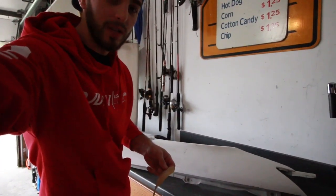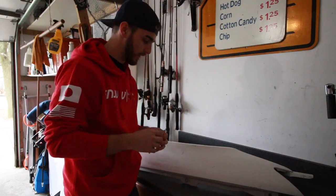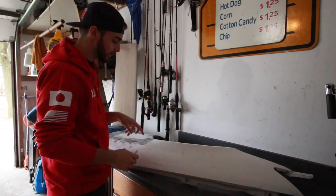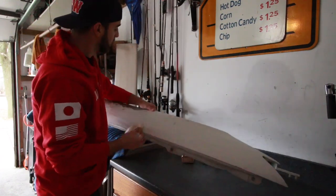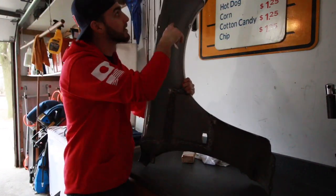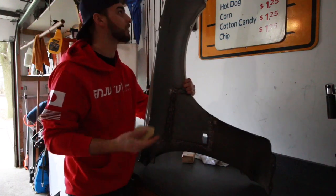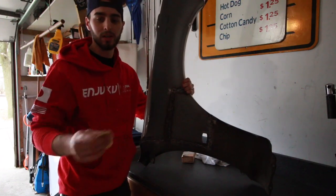And the reason I'm going to be using etching primer is because etching primer will stick to the welds and it has acid in it. That'll help it stick to the bare metal. And then on the back, when we shoot with the undercoating, it's just gonna be there to protect all the welds that Jim did, as well as just kind of keep it from being another rusty 240 part or another rusty 240 fender. So I'm just gonna keep sanding this down real quick, get the other one up here, sand that one,